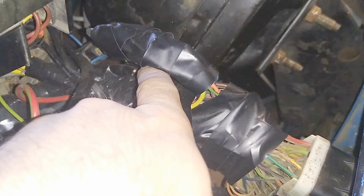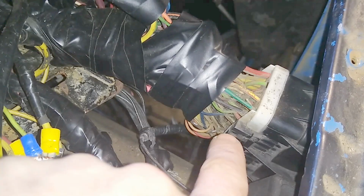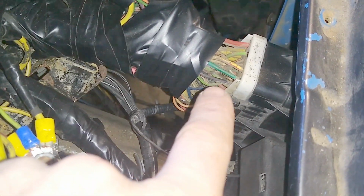Most of the wires in this breakout connector I have reused to splice in either some functions or some switches or the headlight, taillight wiring for the stock 73 harness. Like I said, it's cleaner. I wouldn't have enough space here for the PCM plug and for this breakout connector and the stock 73 grommet. So I just wired everything through here.